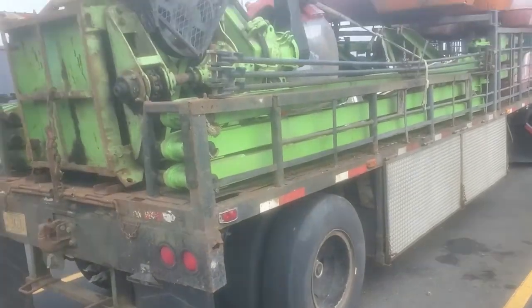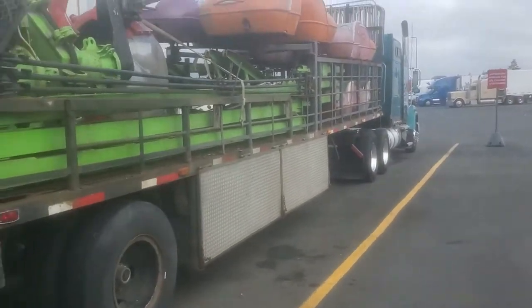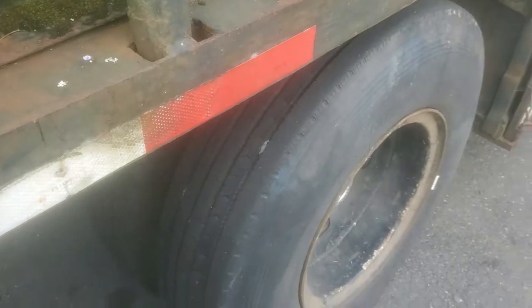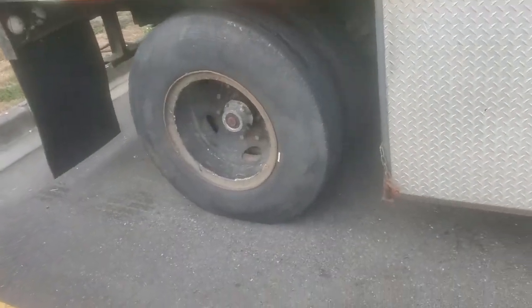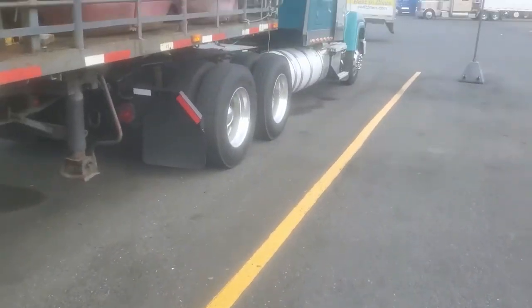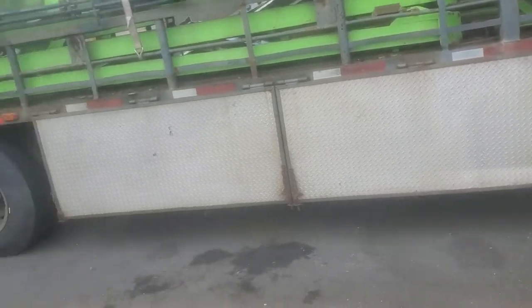This trailer is not much more than basically an empty trailer with the weight of this carnival ride. That one doesn't get a pressure sensor. That one actually has 70 pounds - better than the one on the other side. These are old bias plies - they're only meant to have 90 pounds in them. The other fear I have is if you actually inflate those all the way it creates problems because they're dry cracked old tires. You really don't want a blowout.